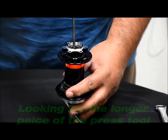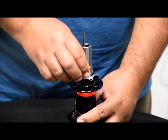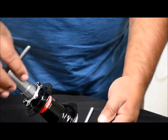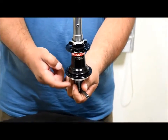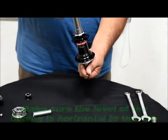Take the other longer tail piece. Put the 28 side down — the larger side down — onto the bearing. Put your threaded rod on it and make sure it drops into the slot. So now the whole thing is assembled like this, keeping it so that the center tube stays down to the bearing side. Put the bearing side down and start tightening up the T-handle.